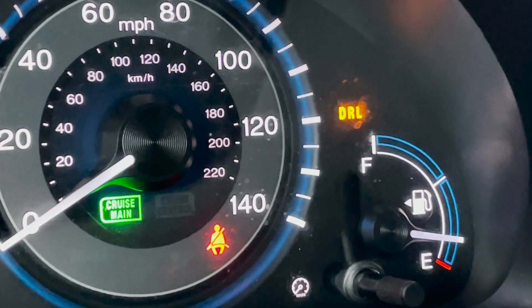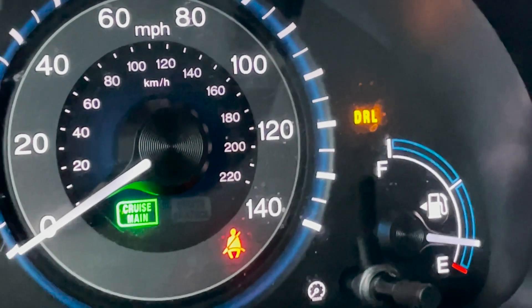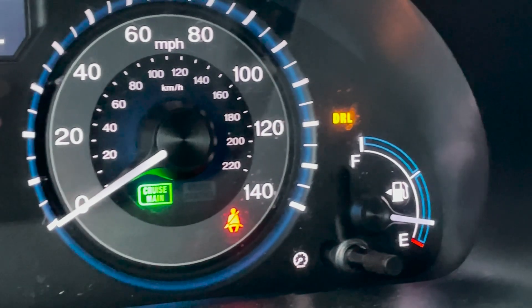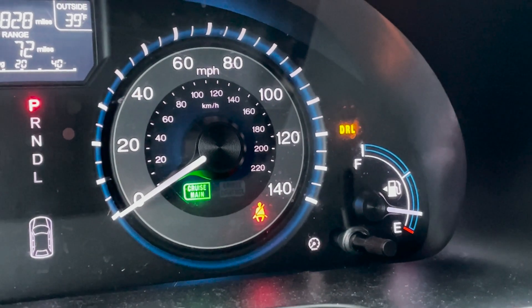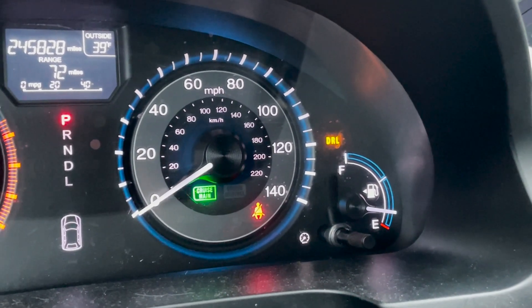You still get the warning light. I think it's because the LEDs draw a lot less power compared to the other type of lights, and the system is confused — it sees the running lights as not on, but they are. So I bought a device called a Canbus decoder that's supposed to get rid of that warning and control things better.